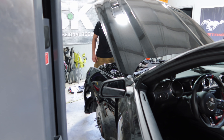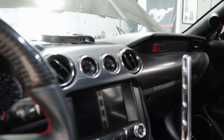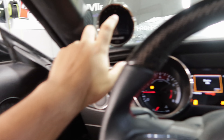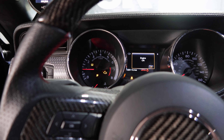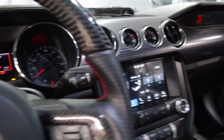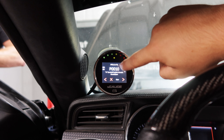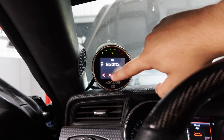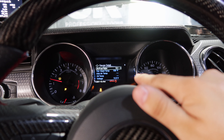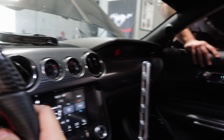Let it run for a little bit — I'll rev it slow, let it fall, do a few things. Oh my god, look at the oil pressure with that high volume oil pump — we're at 90 PSI of oil pressure right now. Check engine light's on, but that's no big deal. I think that's because of the cam phasers. She died. Let's go check the codes — camshaft position actuator open, all the actuators. IAT sensor circuit high. I think the IAT is because we didn't have the sensor hooked up but it should be good now. We've also got no IAT and no oil temp, which is actually what we had before whenever I blew the motor up, so I'm going to have to look into that. It's running and that's all that matters right now — revving up to about 2500 or so.